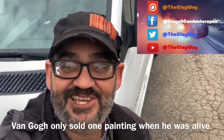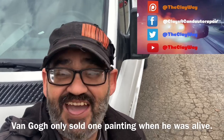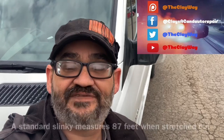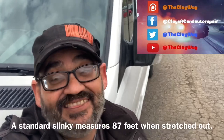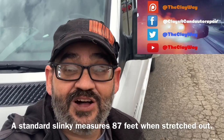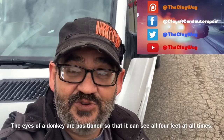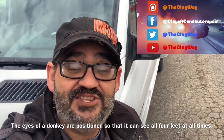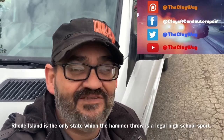I'm very pleased to say it's been about two weeks and about five or six hundred miles with absolutely no problems whatsoever. I did have a problem with the turbo hose blowing off and had to replace an O-ring, but that's just because my turbo is working so well. Hopefully I saved you guys a couple thousand dollars. Eventually you're going to need to do these intakes as carbon builds up from your EGR, but for the time being you're going to be able to get by. Keep rolling down the road — very cheap, very easy.